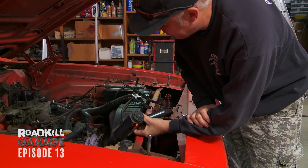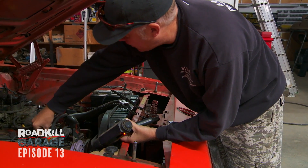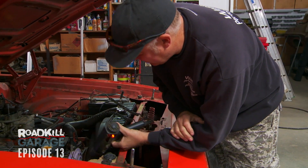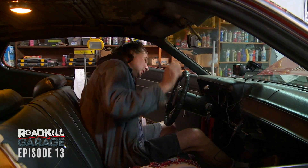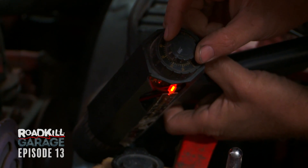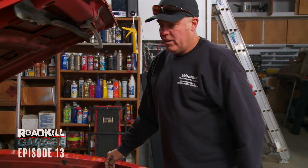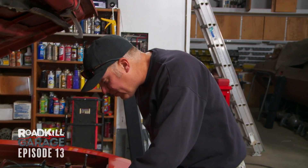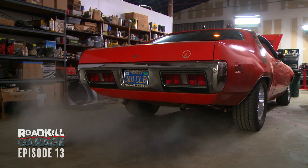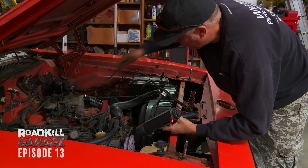Fire's right out. Maybe I should connect the coil wire again? Okay. Rev it up! So it only had 20 degrees of total ignition advance, which is nowhere near enough. So we're going to bump that up. And here it just smoothed right out — oh, that sounded nice.